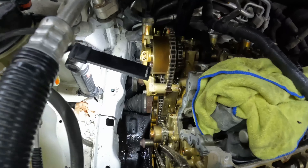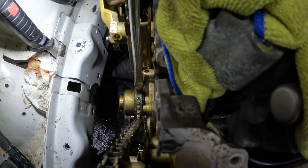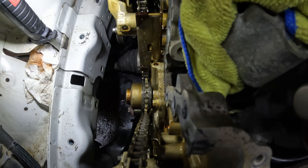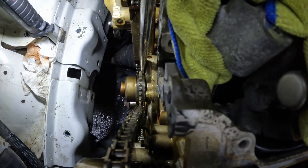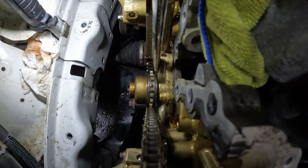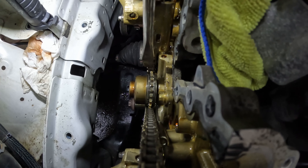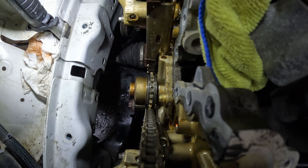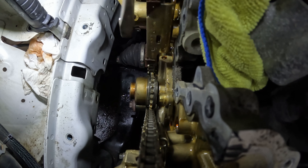So we got that front cover off. I wanted you to have a look at this water pump — the water pump pulley is right here, again driven off the timing chain. Let me show you kind of how loose this is. It's pretty loose. It wasn't making any noise, but it was leaking through that channel in the water pump. We have to flush this cooling system out just to make sure there's no debris in there. There's nothing like doing a water pump job under warranty, so make sure you flush the coolant. Any kind of metal shavings left in the block will destroy a water pump and cause it to leak.